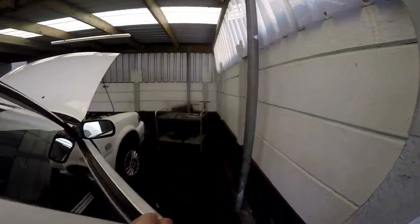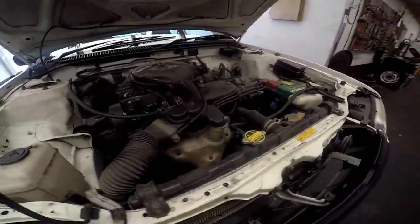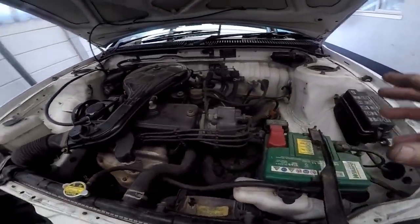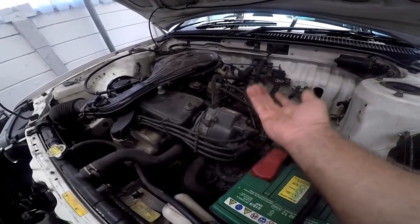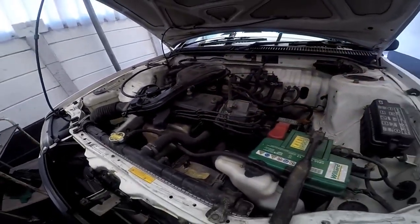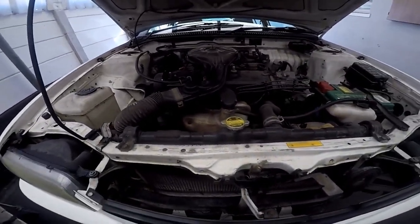Let's go look at the engine. It is a basic 2E engine. It still has the old spark plug wires with a distributor cap. This one is very unusual in that it actually has the coil under the cap built in — a centralized coil because it handles all four cylinders. I'm going to go ahead and just do the basic oil change and filter change.